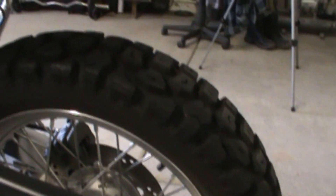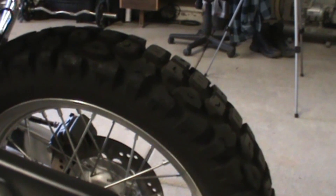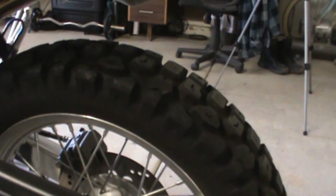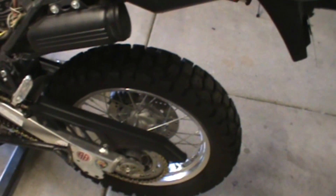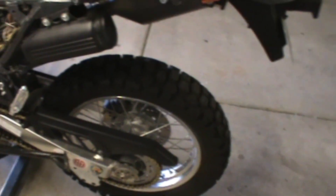Shinko 244s — I got the 5.1, which is a little bit wider than stock. It fits just fine, no problems. They are a 70/30 tire: 70% off-road, 30% on-road. They are awesome off-road and fine on the road, but when you are cornering you will feel those side lugs — it's a little unnerving, but you get used to it. If you want a true 50/50 tire, the Mitas E07s are amazing on the road and way better than the stock Death Wings off-road.